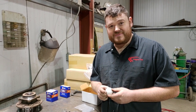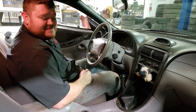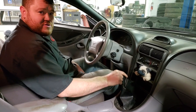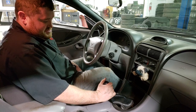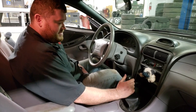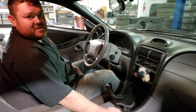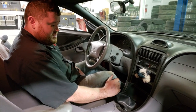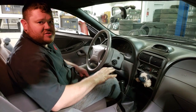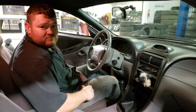This is a really simple process and anyone should be able to do it — it's one of the first mods I did on my own GTS years ago. Before we start putting in the new one, let's demonstrate how crappy the old one is. Right now she's in first gear — this is how much play you have in first, which is pretty bad. Pretty much every gear has the same amount of play. The worst part is the full travel: from third down to fourth is five inches of travel from the top of the knob, and going from second to third you have to go over further and up too. Your travel is all over the place, greatly exacerbated by the long handle in any gear — not just straight forward and back.